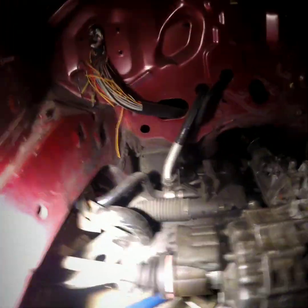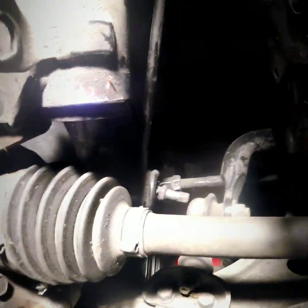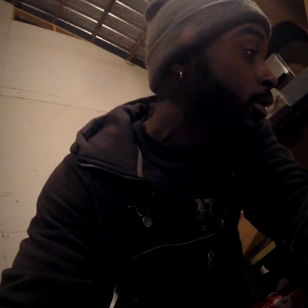As you can see, the power steering lines are going inside the car because we are doing electronic power steering. The Haltech is also running back inside the vehicle - we're going to be doing a Haltech Elite 2500 on this build. The nice thing about this setup is I don't have to run sway bar endlinks off the suspension anymore because on the Evo, the sway bar endlinks are actually attached to the lower control arms. That sparked my interest in the methodology of the Evo X all-wheel-drive platform - I'm going to try to come up with a shorter endlink basically.